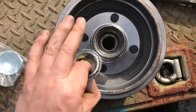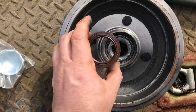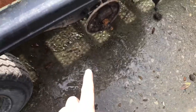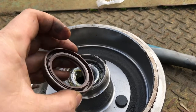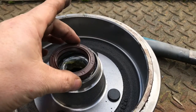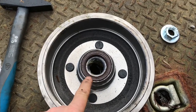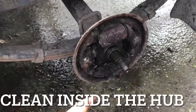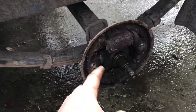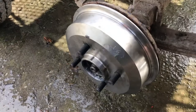The wheel bearing is all greased up — drop that in. Now we have to get the seal in, then tap all of this onto the hub. I'm going to install the seal this way. That's the dust cover now put in, the bearing is in. This is the back of the drum going down here — and since it's off a car transporter, we don't actually need the drum brakes, so all the brake components are missing. After a few gentle taps, we got it in — it's turning lovely and smooth.